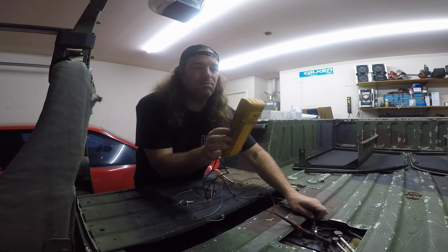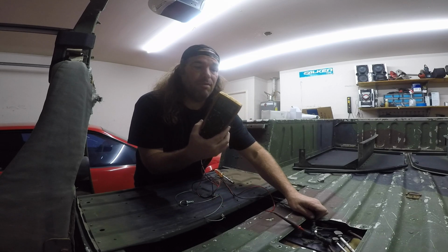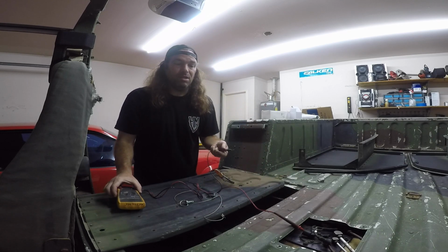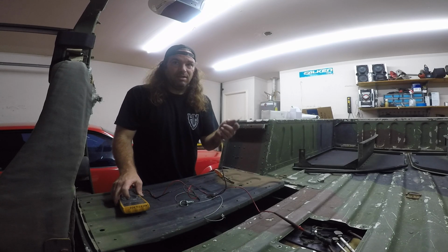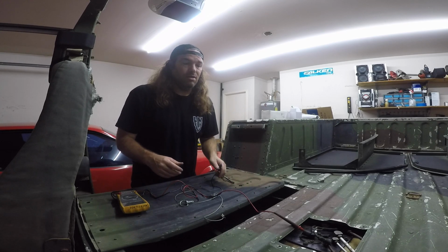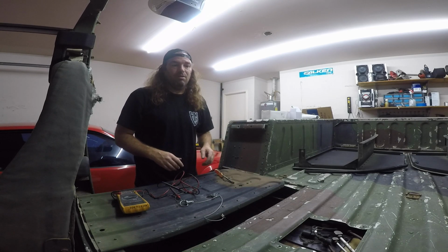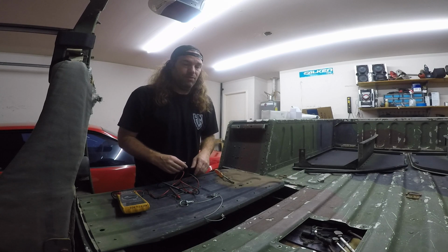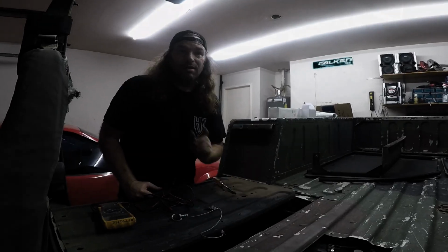800 some odd ohms, 1,000 ohms, 900 ohms, 1,100, 1,500, 1,200. If I'm not mistaken, I think these things only measure something like 0 to 200 ohms. So if we're going way over that, obviously this would show why the gauge is thinking it's all the way full, because it's seeing a massive amount more resistance than it really should be. So anyways, what I think I'm going to do is go ahead and replace the sender unit, and we'll see what happens. Stick with me.